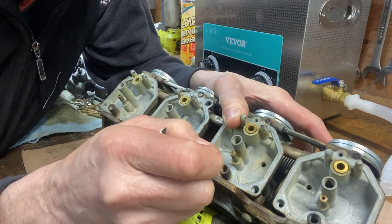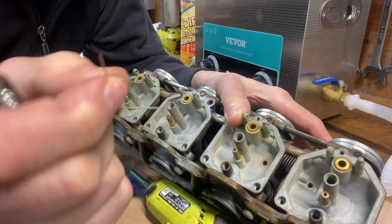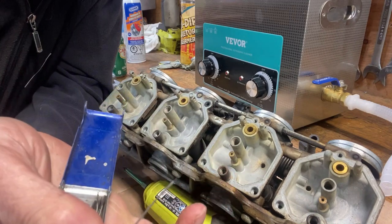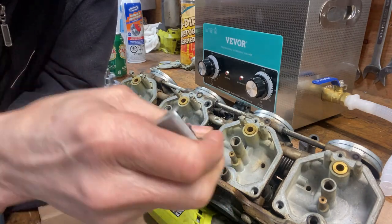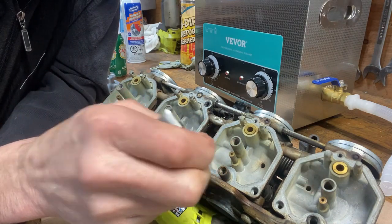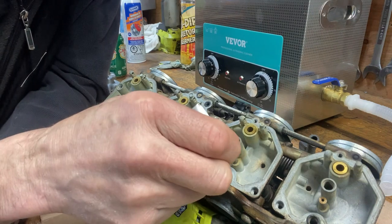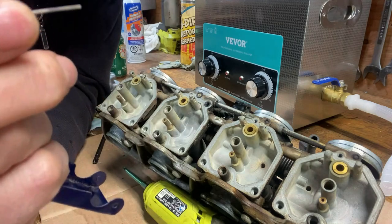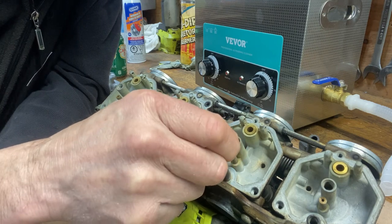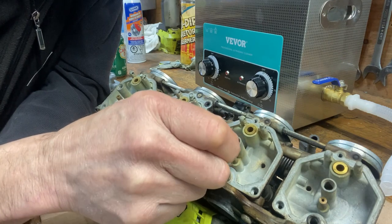And usually the idle circuit jet is so fine, just a very fine piece of wire is gonna get into there. This is actually even would be too thick. But this one has a little bit larger hole in it. I'll show you. I'm using a welding tip cleaner. I thought, if that's a really fine little hair hole in there, I'm gonna have to pull these jets out and clean them out or somehow get them out. But it's actually a pretty good size hole in there, and then it's metered by this. So it's less likely for that to plug up, or if it does, it's a little easier to clean out with one of these. So I can stick this in, and I hit a ridge. I'm hitting a ridge about that far in. And then if I wiggle it around in the right spot, it'll drop. Make a liar out of me. Come on.